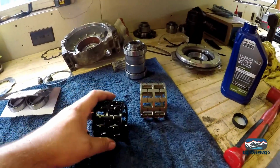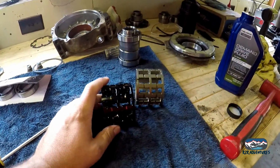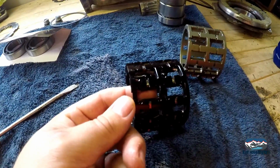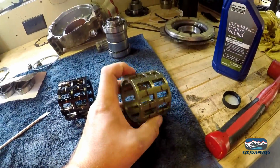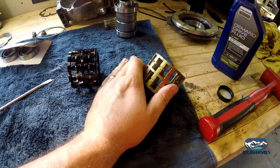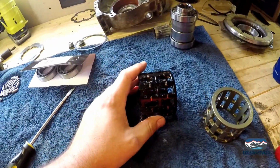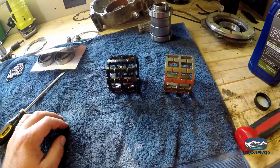It should go great. And while he's been doing that, I switched the H-clips over. My hands are all full of oil. I didn't want to use the camera and do this at the same time, but they pop off with a screwdriver, and then you just snap them onto the new carrier. Usually the Polaris plastic ones are destroyed when you take it apart, so the H-clips are kind of like a hide-and-go-seek thing. These, I took every single one off. It's just a screwdriver, pop them out, pop them in. Very self-explanatory. Just make sure they go in the same way. Make sure you have every one.